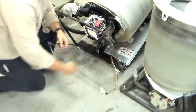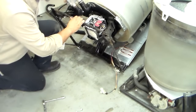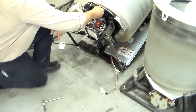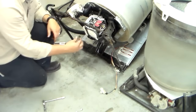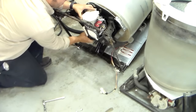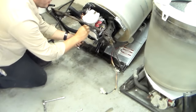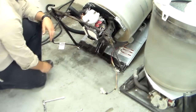I don't think you guys need to watch me run the rest of these screws in. When you put the pump back on, because you're going to be working underneath the bottom of your machine, you want to take this top clip and stick that in first. Make sure you're reaching up under so it's up just like that, and then you'll be able to get to the bottom one. Line it up and spin the motor coupler until it drops in. Now that it's dropped in, you're going to be reaching up under. Snap the top clip in, go ahead and insert the bottom clip and snap that in. Go ahead and connect your wires back up and tighten the rest of your bolts up.